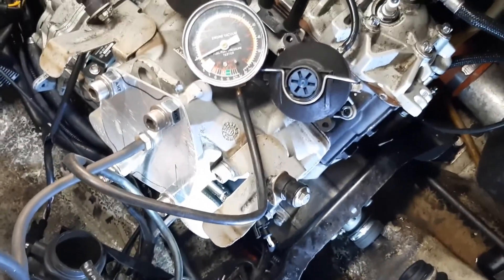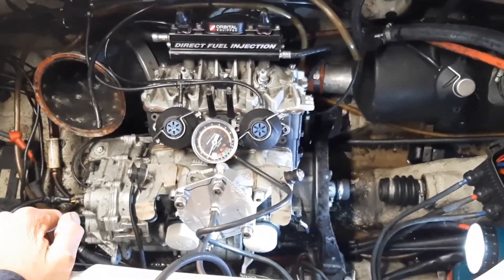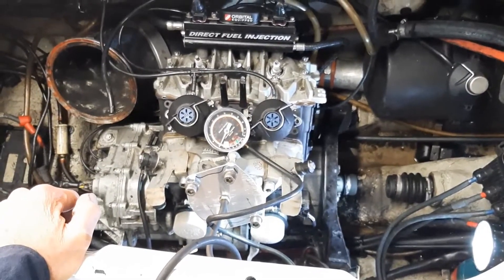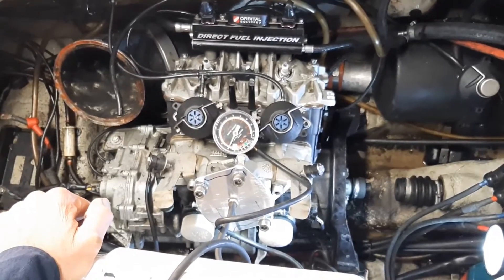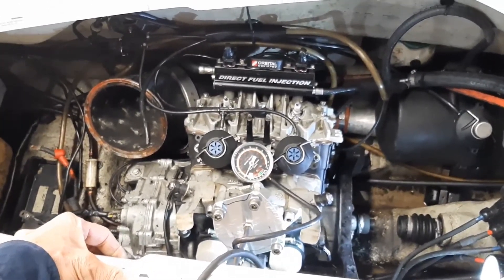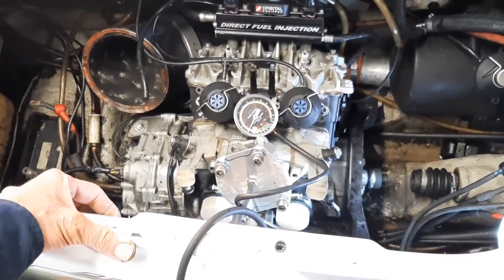I think we're looking good. It's been a couple minutes and everything seems to be holding tight. I think the assumption that our bottom end is good was a good assumption, and I think we have a tight engine. We're going to eventually run it and do the compression test to make sure our bore job was good — we're looking for 125 to 130 to 135 psi on a DI. We've done everything we could to prove that our direct fuel injection system is tight and operating properly. Our top end is good — tight and fresh — and our bottom end is tight. We should have a really good engine here, and we're going to finish putting it together and run it for you.